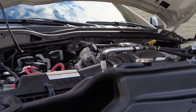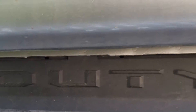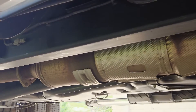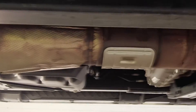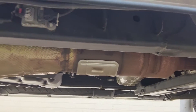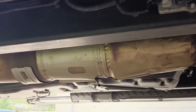More so to think about is the DPF — the Diesel Particulate Filter — which is underneath the truck right here. New diesel owners, you have to be aware that your truck has diesel exhaust fluid. Looking under here at the DPF, it looks like a big torpedo underneath the truck. The truck needs to do regens in order to keep the catalyst that's in this filter free of soot.